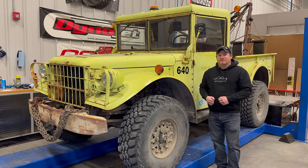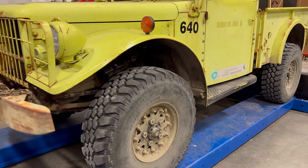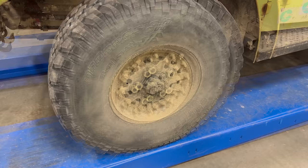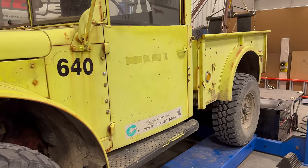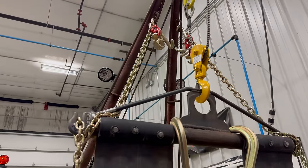Today I'm back with the vintage off-road wrecker. I've done a few things since the last time you've seen it, but there's still a lot more to do. Both the front and rear axles have been upgraded with lunchbox lockers, so I do have some lockouts to put in the front to keep the wear and tear on the front axle down, as well as being able to steer when I'm in four-wheel drive. If I want to, I can unlock one side.